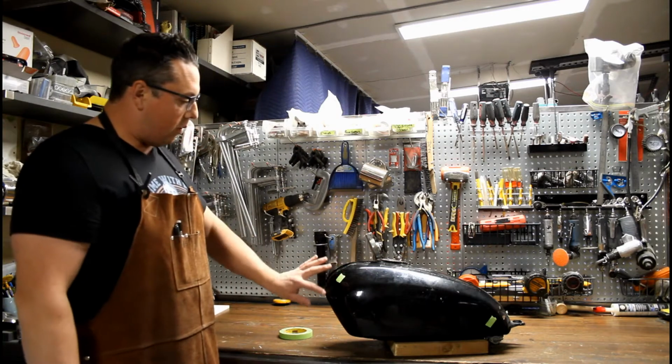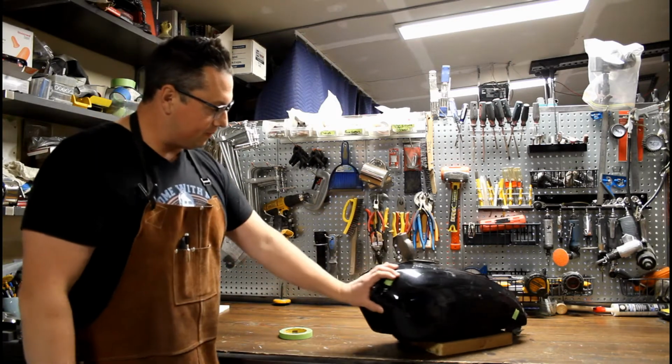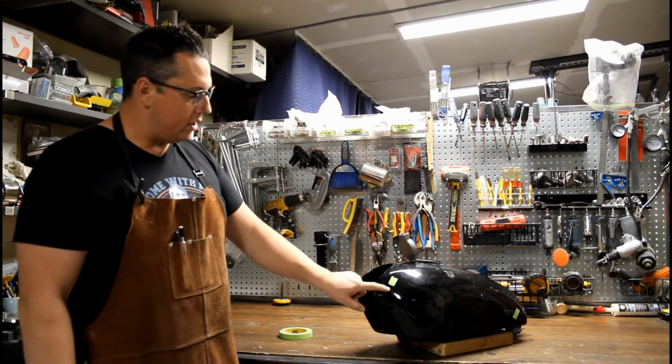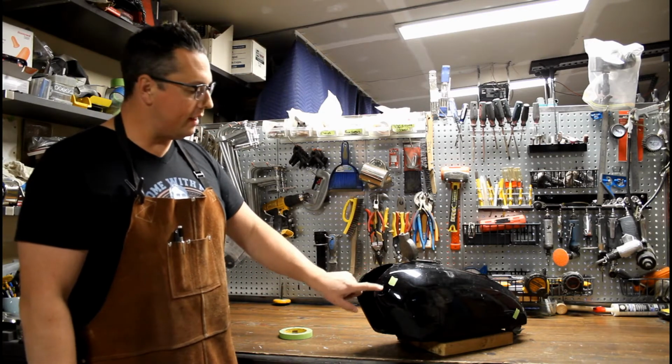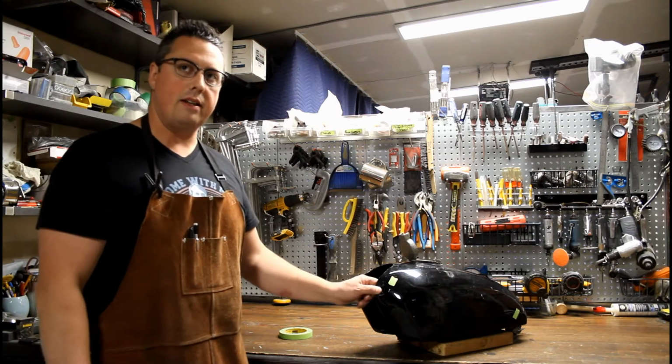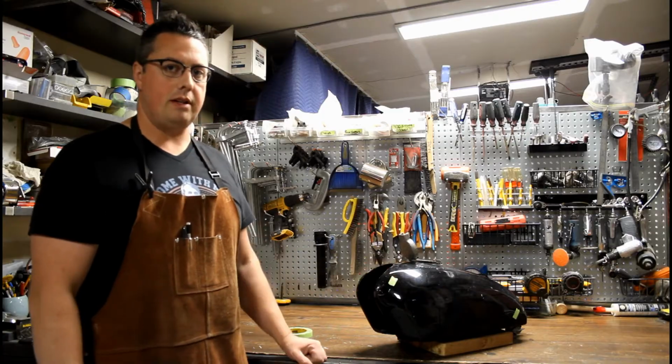So we're gonna start with our worst damage. Now, it's really hard to get in there to repair it. So we're gonna strip it off, we're gonna get the stud gun, and we're gonna pull this. And basically what we're trying to do here is replicate the damage in the opposite.